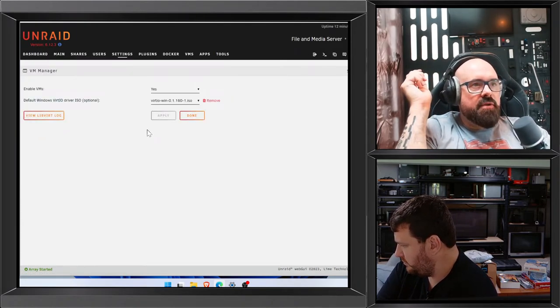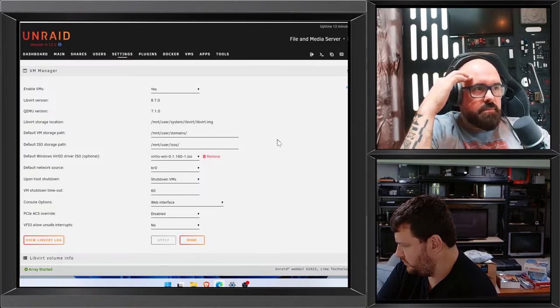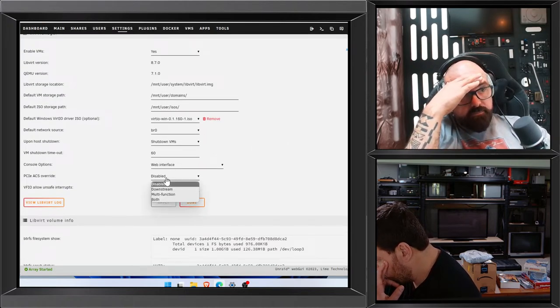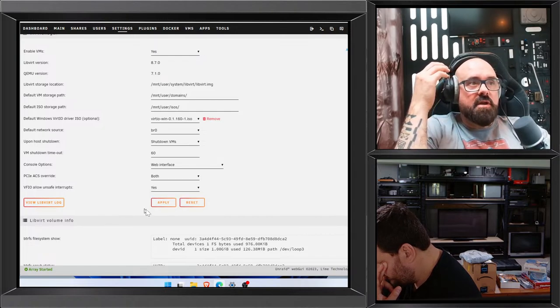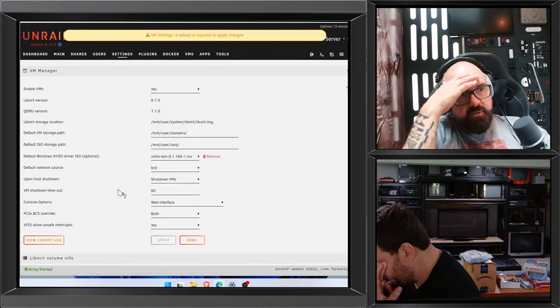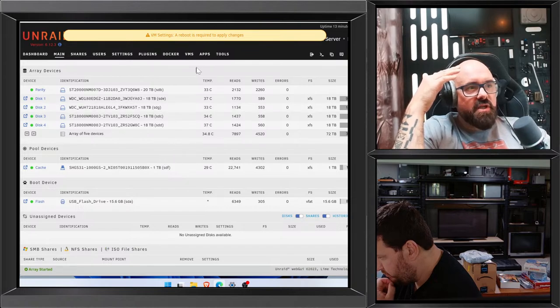Okay. And you need to enable the advanced tab. And PCIe ACS override. Can you click onto that and select both, please? Okay. Yep, and let's allow VFIO unsafe interrupts. I don't think we really need that, but it won't hurt for what we're doing. Then click on to apply. We will need a reboot for this to take effect, unfortunately. And just click done.